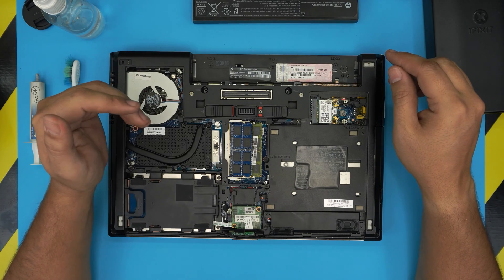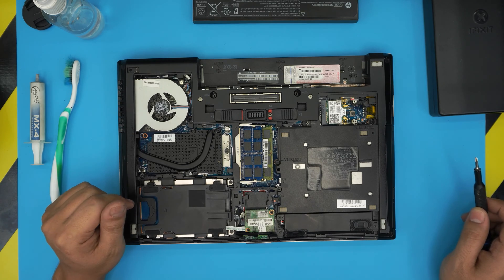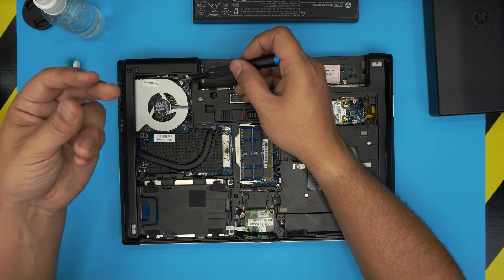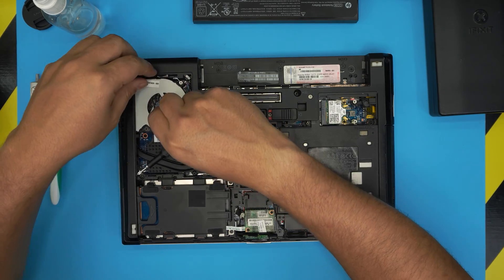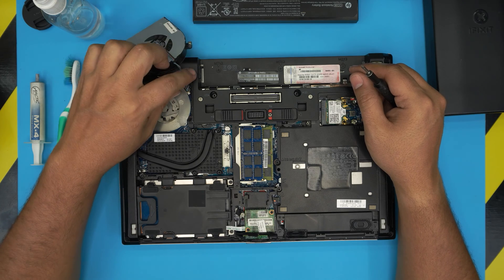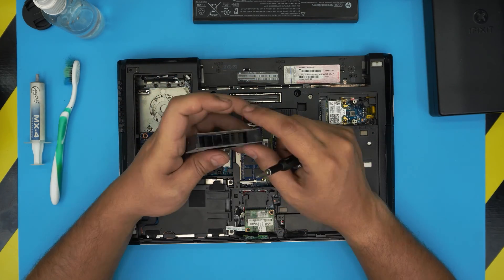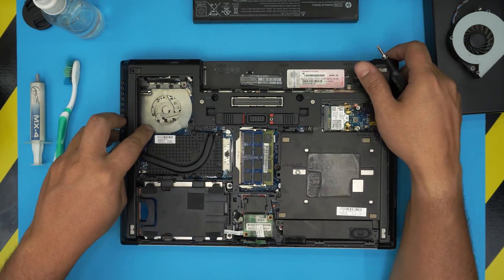Inside you'll see the RAM, the hard drive, and the fan system. This one has already been cleaned and repasted recently, but I'm going to do it for you since you requested it. To remove the fan, loosen the two screws — these have a C-lock so they won't come out entirely; a spring will push them up. Loosen until the spring pops up, then grab the fan and bring the back side out. Disconnect the fan connector by grabbing it from the bottom and pulling up. Note the orientation of the connector. Take the fan out and clean it with a toothbrush, blow compressed air inside — yours might have a lot of dust.